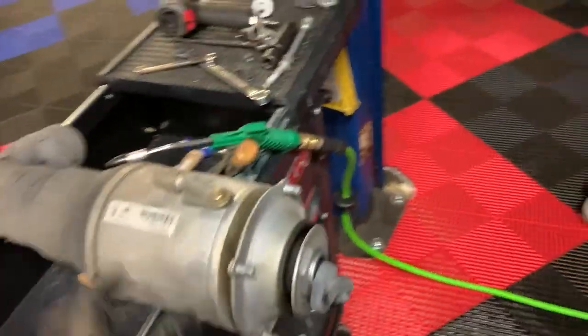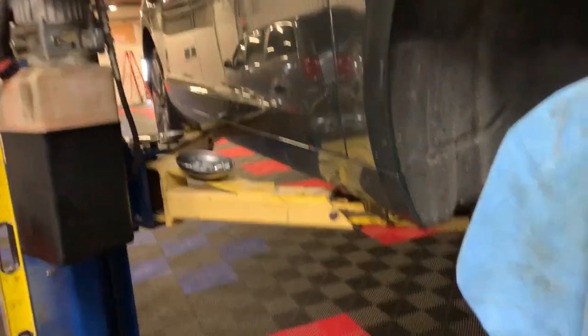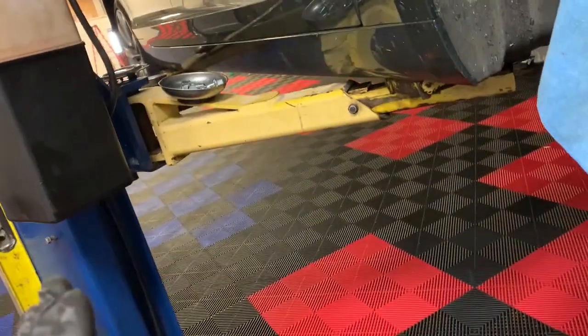Super easy. The only thing you have to remember is to shut off the air suspension. Make sure if you have the car up in the air, you use jack stands. Do not trust a hydraulic jack to hold the car up. Please always use jack stands or blocks of wood, something to keep the car from falling on you. I have the luxury at the moment of using a rack, so I have it on the rack. But anytime you get it up in the air with the rack, you still have to be sure that if I'm going to lower it, I'm not hitting the wheels on the ground to knock the car off the rack. So always exercise precaution at all times.